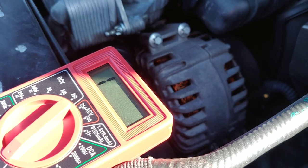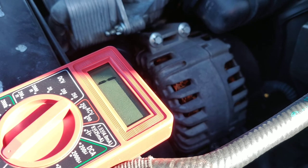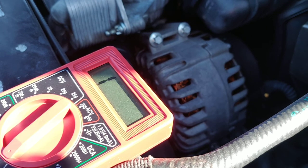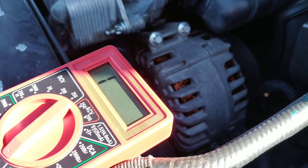I'm going to be getting a new alternator. One important note: you do have to disconnect the battery when you do this test. If you do it with the battery connected, it will show that it's drawing no power. But if you disconnect the negative battery lead, then you can go ahead and test it and it will give you completely different results. So do it with the battery disconnected.